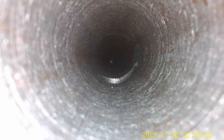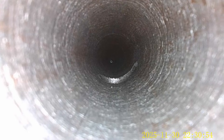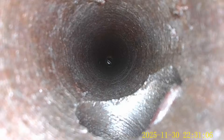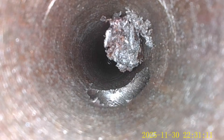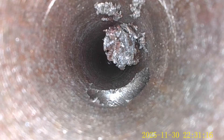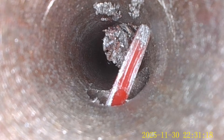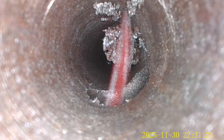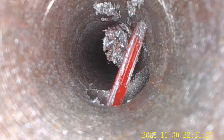When I went to go to three, I had a hard time — that's the center main. I actually had to pop that out because it wasn't all the way drilled through good there. Look at that — there's another piece of debris coming out of there. So these blocks need some TLC. I think every galley needs to be cleaned out and without doubt needs to be ground out or smoothed out. Because look at that — that's where the thrust bearing would be right there.